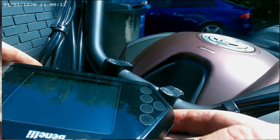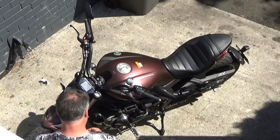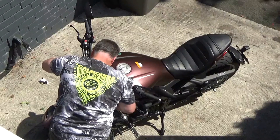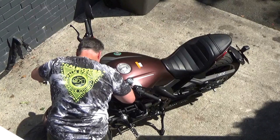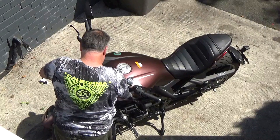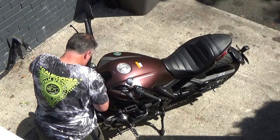After getting our head straight on what the job entails, the next step is to unclip the LCD screen. This is quite fiddly — there's a weather cover underneath, and then a block connector, a quite wide one which is nice and easy to handle. You need to roll the weather sheath down first so it's out of the way and doesn't keep flipping back while you're trying to reach the button. It's a standard clip: you'll see two plastic lines, and in the center there's a push button — push that as hard as you can and wiggle the connector, and it'll clip out.